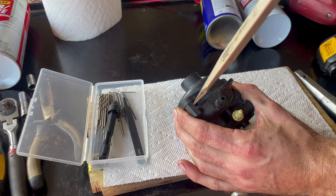I'm going to take my micro drill bit, put it in there, and just work it back and forth — hand-drilling it to widen that hole. We'll know we're finished when we can move that drill bit nice and smoothly through there. Then we'll clean it up with our air compressor through all three of these holes.